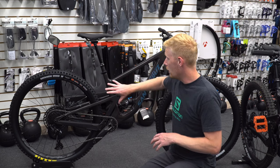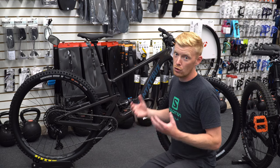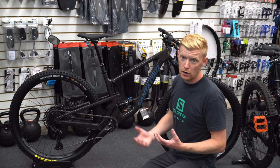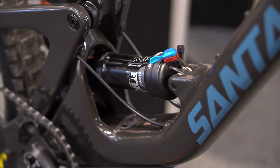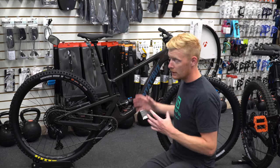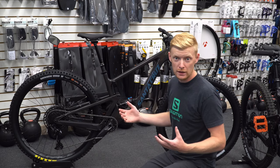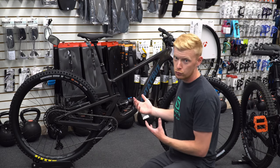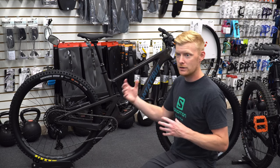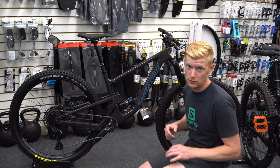You don't need to worry too much about the weight difference with the carbon frame paired up — you still get an overall lightweight full suspension bike. This one has the Fox Float rear shock paired with the Yari up front, so it's a 150/140mm travel setup with 29-inch wheels. That makes this a super fast-rolling frame, but a bit slacker than the 5010, closer to where a Bronson would be. It's really going to roll over aggressive terrain and downhill a lot faster — this is the everyday trail bike and enduro bike.